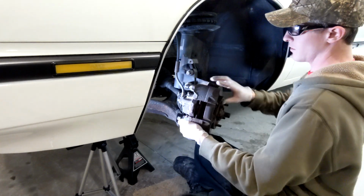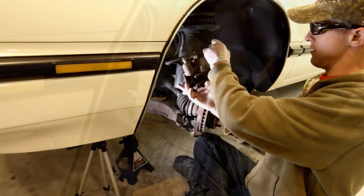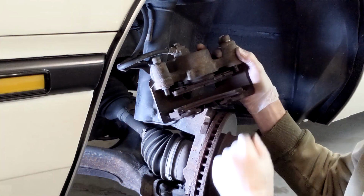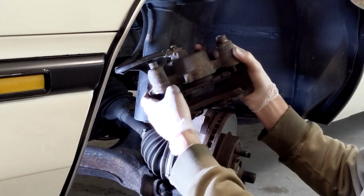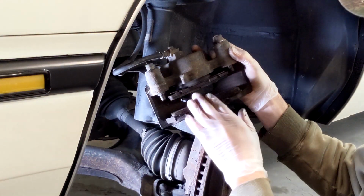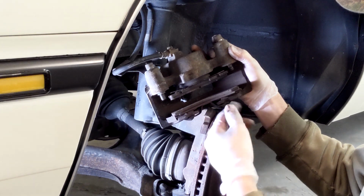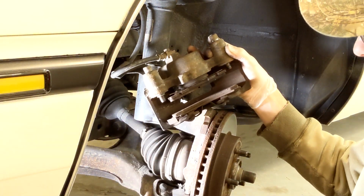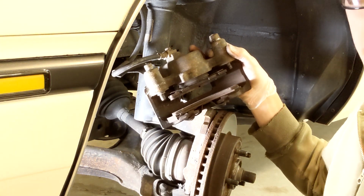Lets this come off a little bit easier. So, okay, all right. Hopefully you guys kind of see what we have. I'm looking at the wear on my pads here, and I'm noticing the shim is separating from the backing plate. That's kind of interesting to see. But no taper on the pads, no front or back, anything like that. So it tells me my hardware is good, and all of that other good stuff. So that's good. That's what we want to see.